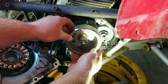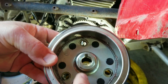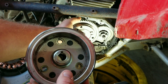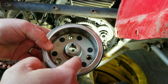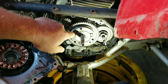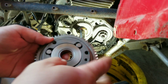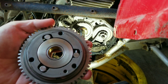You can see the little keyway there. There's your keyway - don't lose this key, it is loose and can pop out. Normally this starter clutch would be attached to the back of the flywheel, but because our bolts backed out it's unattached. There's our flywheel clutch and the weights that allow that to work the way it's supposed to. Time to put our new one of these in and start reinstalling things.